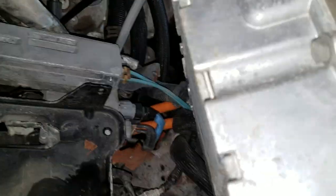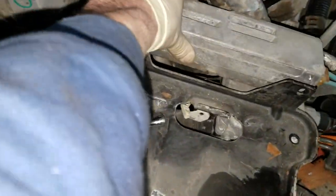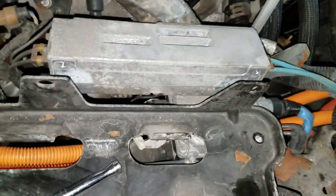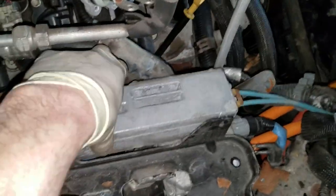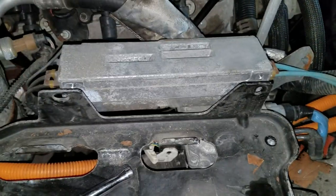On this one I didn't actually have to completely disconnect the inverter itself because we're not replacing that. What we're replacing is the power steering control module. They lost power steering in this vehicle and it was setting some codes, and we diagnosed it down to this power steering control module. So we had to get the inverter up out of the way so we could access it.